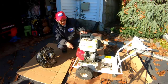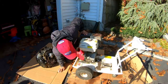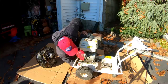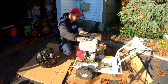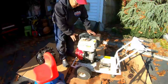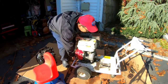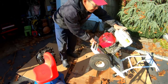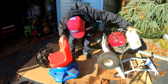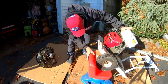That'll be interesting. So I'm gonna have to tilt this somehow to get to the bolts underneath. Or I could just grip it somehow with a wrench. But I really don't want to tip it, you know what I mean? Because the carburetor is on the front part of here, you don't want to tip it that way because oil will leak into the carburetor and you have a lot of cleaning to do. This is not so heavy, because the dipsticks, one on this side, one on the other side, are in the rear of the engine. We just tilt it like this really quick, and that holds it in place, sort of.